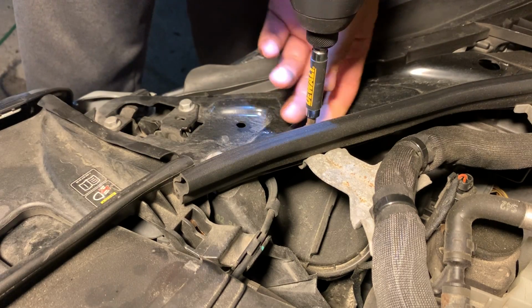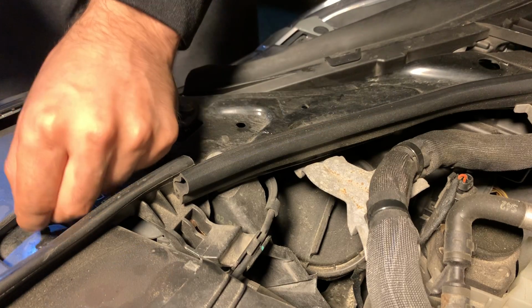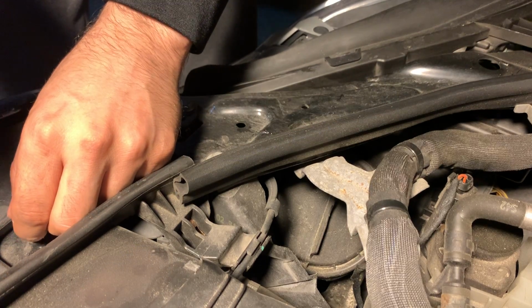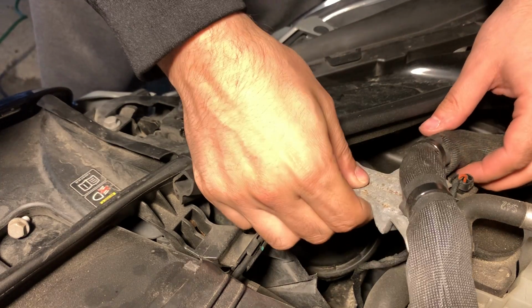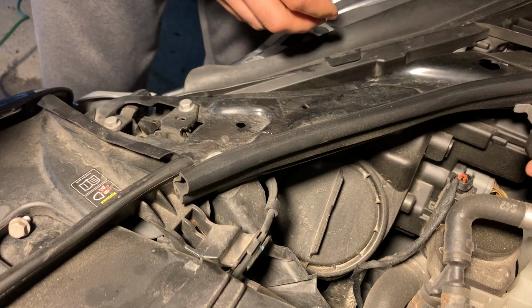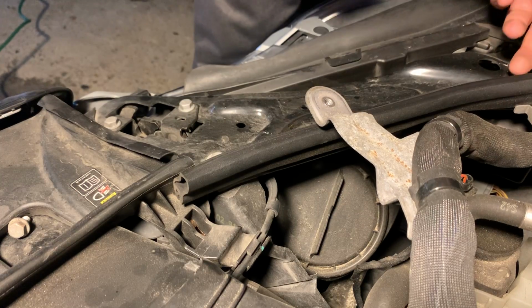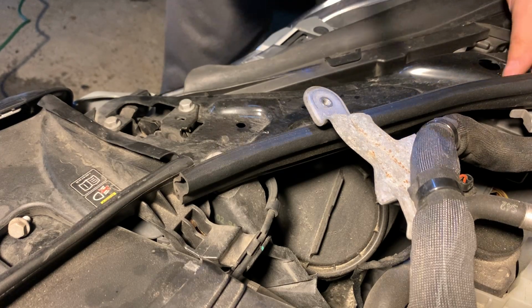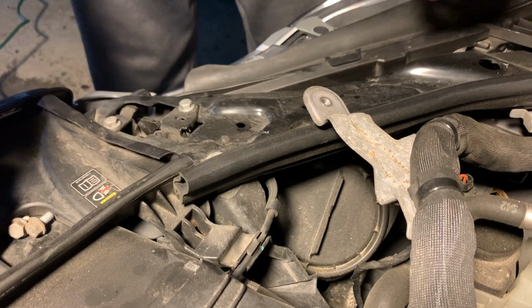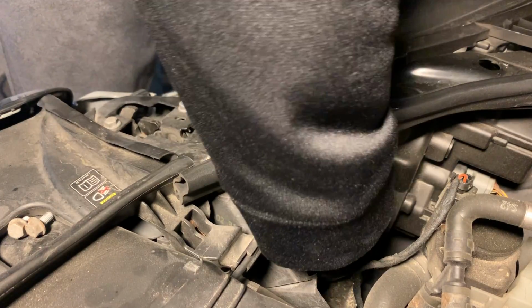We're going to replace both corner lights and we're going to start with the passenger side. This is not the side where the light is burned because the light is actually burned on the driver's side. But this gives me a good opportunity to show you guys how you can change the bulb on both sides, on the passenger and on the driver's side. Here I'm making some room by removing two screws that hold this cabling, and then we're going to tuck those cables on the side. Take the round cover off by rotating it counterclockwise.